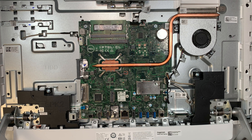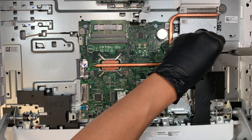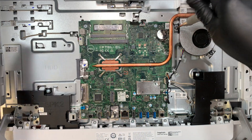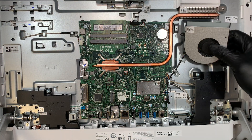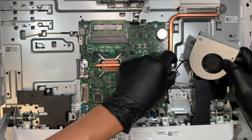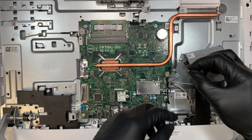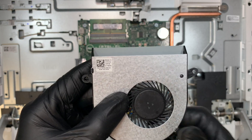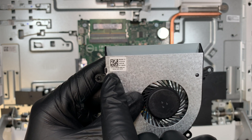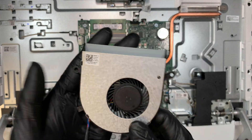Let's go ahead and remove the CPU fan. If you feel the CPU fan isn't working properly because it's very dusty or otherwise failing, remove the three screws and lift the fan out. The connector just pulls straight up — no safety clip or anything. It's push-in to install and pull to remove. The replacement model number is CN-01 TMP6.